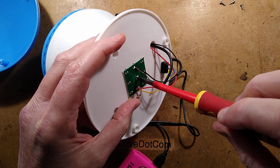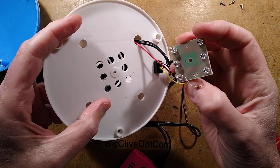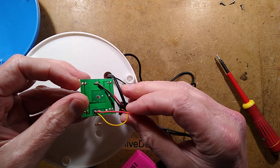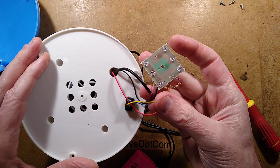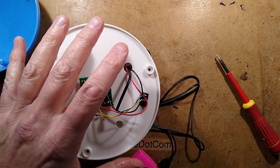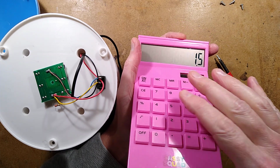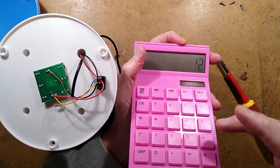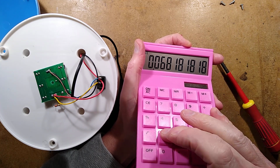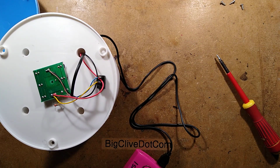Let's pop the circuit board off. There are 8 holes, but the circuit board only has a position for 6 LEDs. Okay. Oh, let's work out the dissipation of that resistor as well, see if it's going to get hot. To work that out, it was about 1.5 volts divided by the 22 ohm resistor gave the current, which is 0.068 amps, 68 milliamps, times the 1.5 volts being dropped. It's only 100 milliwatts. That's less than half the rating of that resistor. That's very good.